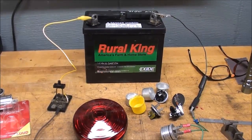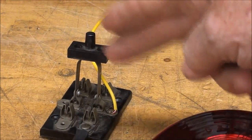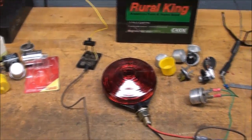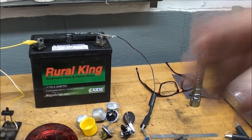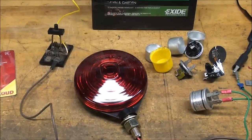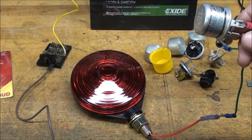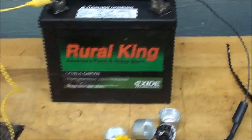I've made a little experimental setup here on the workbench in the basement. I've got a 12-volt battery connected with a little knife switch — no right and left, just turns it on and off. Follow the wire: it goes into one side of the light, out the other side, through the flasher, and back into the other pole of the battery. Polarity doesn't matter at all here. When I throw the Frankenstein knife switch, the flasher starts — perhaps you can hear it. I can certainly feel it.